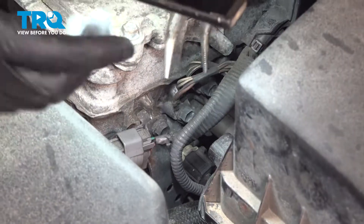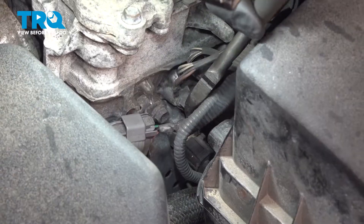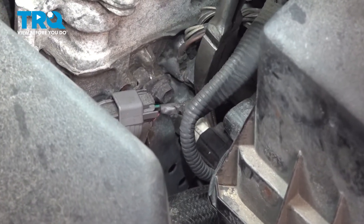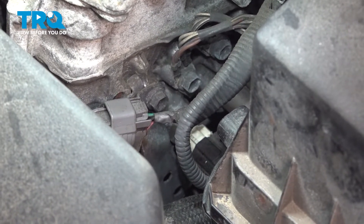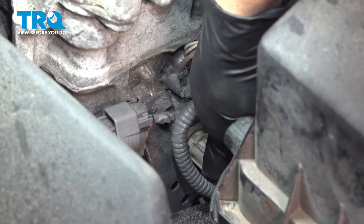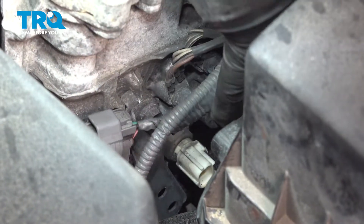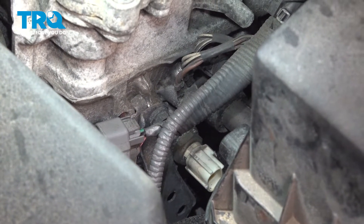Okay, so I broke it free. I'm going to stick my pliers in here and try to pry it off. There we go. Get that off. Now you'll need a 19 millimeter socket, a deep socket, to put over that sensor.